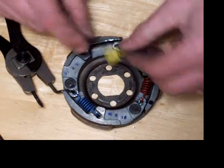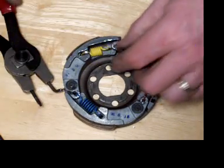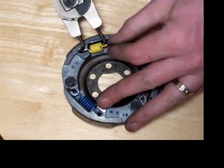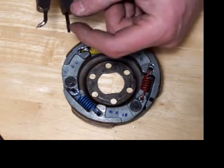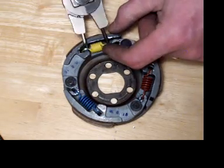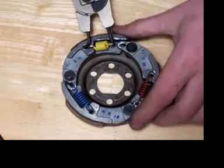Same thing goes with putting springs in. Just start with one side. Again, this is the Leo Vince Yellow. This is a fairly stiff spring. Don't know whether you can see it, but this snap ring has a little bit of a point on the end, with a little lip, and it's important to get it so it kind of rides on that lip, doesn't slide up the point.